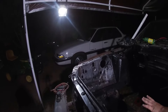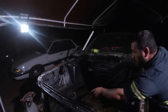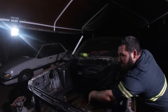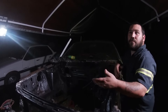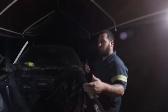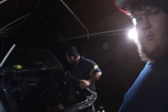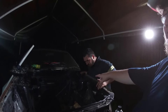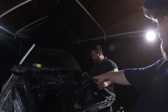I did clean up all the wiring on this side — the starter solenoid is off and all that wiring's cleaned up. That's how we're going to put the smoothing panels in. I believe that's going to open up some more mounting options. We're probably going to move the battery to the back, though the only issue is you've got to run some pretty thick cables due to resistance — you lose a little starting power.